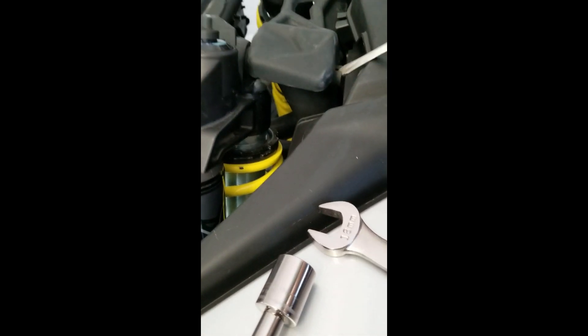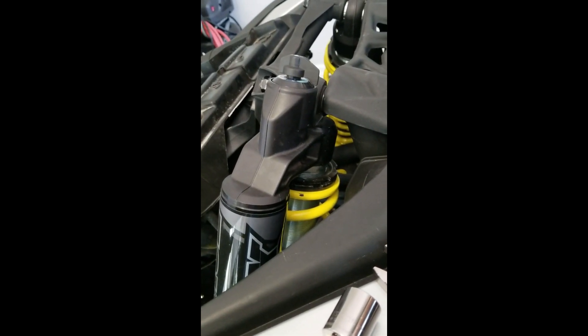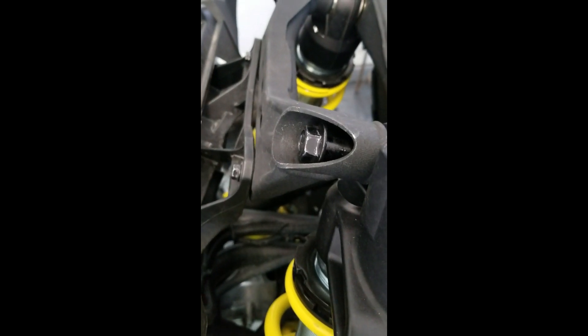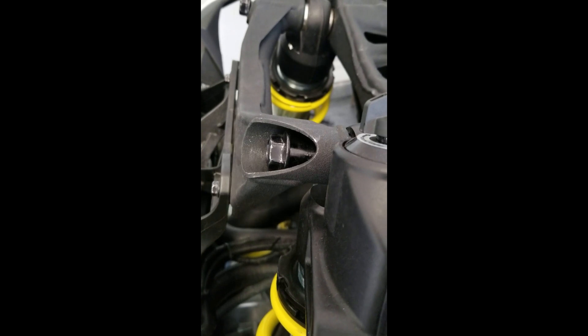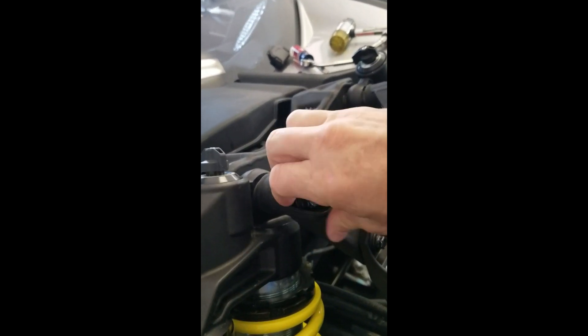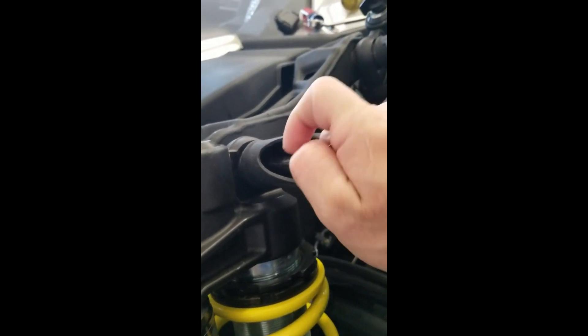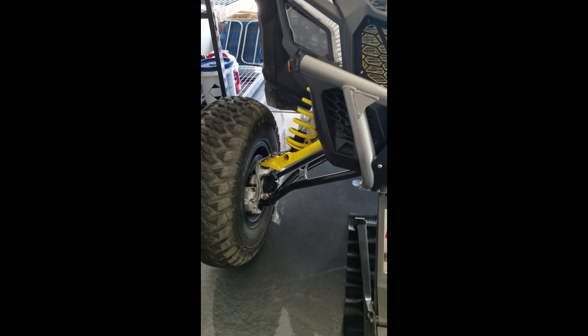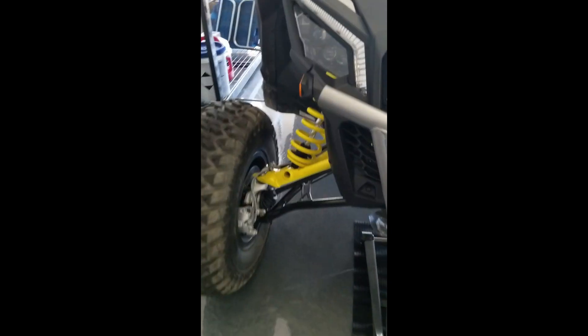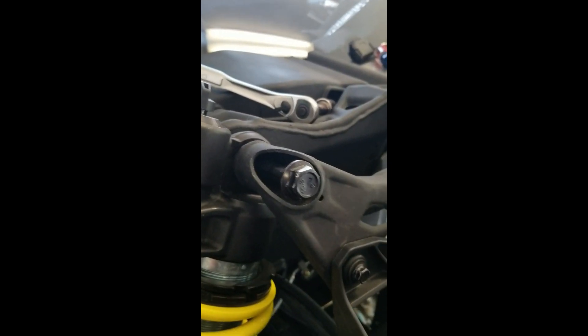What I do is take something to apply just a little bit of pressure while I'm torquing out and pulling out the head on the bolt, to kind of force it up so you can get a gap there. Once you get a gap you can really do anything — continue to back it out or put something in there to push it. As you can see we've got clearance on this particular bolt here, so I'm just going to work it. I'll let the jack down just a little bit until the wheels just about touch the ground. That was a little much so I'll pull it back up, and then this is going to come right out.